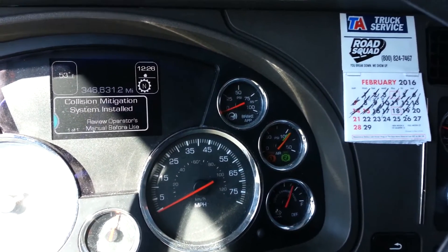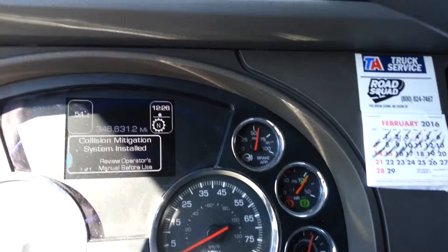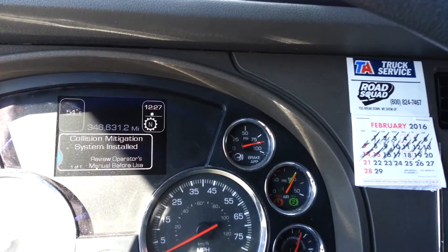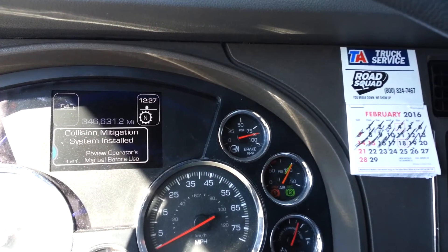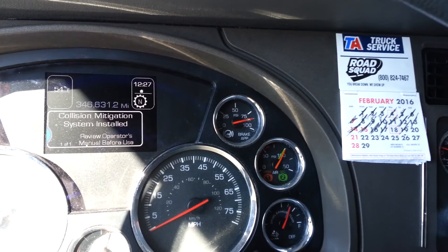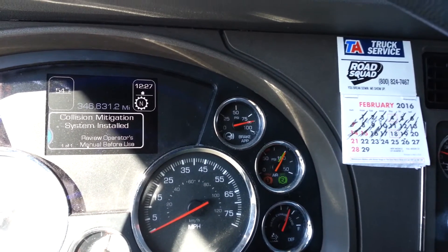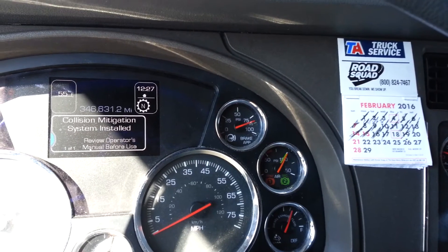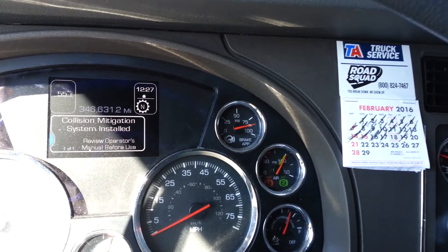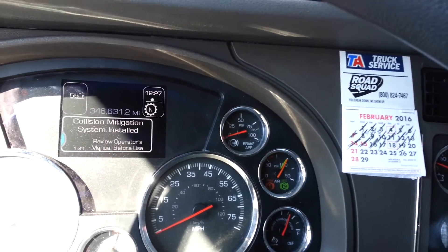To do your leak down test, you just hold your brake down. Pick a nice number — 50, 75 — or you can just push the brake all the way down. My truck maxes out at 85 PSI. If you have a stopwatch, you just want to count down to a minute or 30 seconds, but one minute is what the DOT is going to ask you to do. So after 60 seconds, you should lose no more than 5 PSI. My needle hasn't moved — it just started moving because my leg got tired and I started letting up. But that is the leak down test.